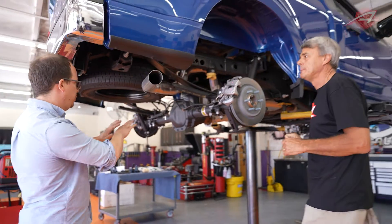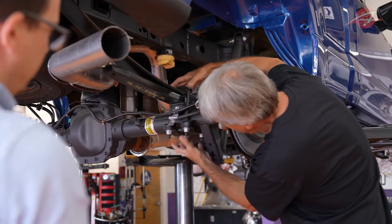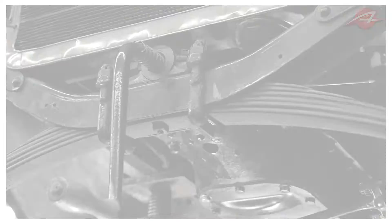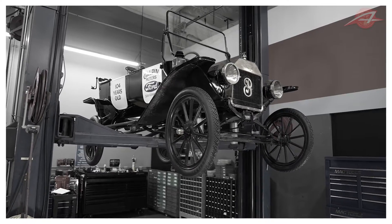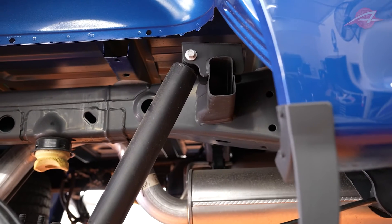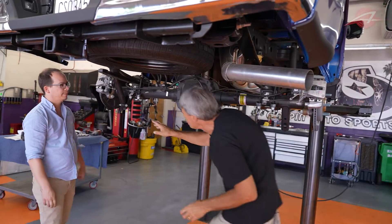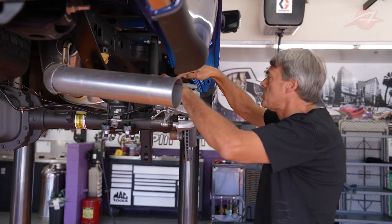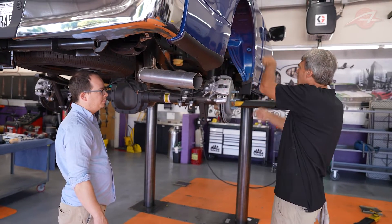The spring is held to a rigid axle — it's bolted solid with these U-bolts to the axle tube. The Model T had U-bolts as well, same concept, except here the spring is U-bolted to the axle rather than the frame. The Model T didn't have shock absorbers, but this vehicle does. All vehicles have shock absorbers now, and here we see a perfect example of staggered shocks. This shock tips forward and is attached to the front of the axle, while the other one is mounted to the back side of the axle and tipped backwards. The reason for that is these springs are fairly flexible.